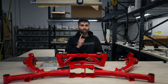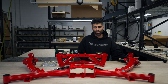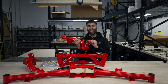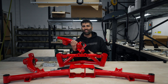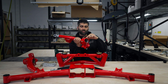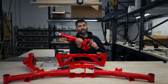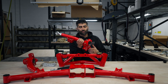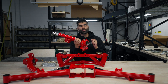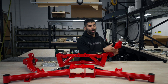If you have the R200 version, you will need to trim a little bit on the car — I'll show that shortly. The other thing to note is our bearings: they are machined and then welded, so they're slightly larger than the factory bearing, about a sixteenth of an inch give or take. Some brake kits fit very snugly around the factory bearing, and because ours is machined before welding we had to maintain that thickness to prevent warping. We tried to make it as small as possible, but tolerances required it to be a little bigger, so depending on your brake kit — especially aftermarket — you may need to open up the bearing cup slightly.